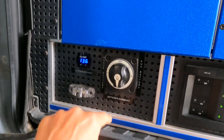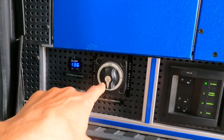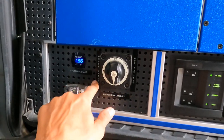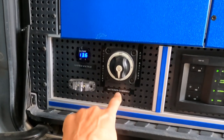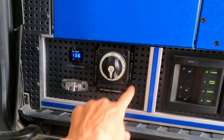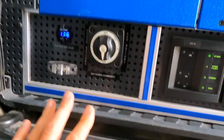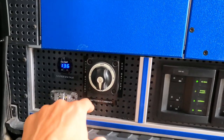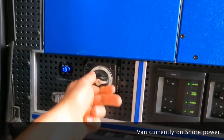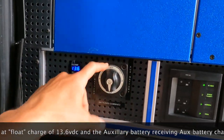The wires tie into my main electrical panel, and I have a battery switch here that some of you may have seen in my other videos. This switch brings in the auxiliary battery — you can see they're combined right now — to my house battery. Normally it's combined with the house battery because after the engine starts there's a time delay, after which the auxiliary gets connected to the starter, and then after the timer it starts feeding power through this switch to the house batteries. When the van is sitting idle all three systems are disconnected.